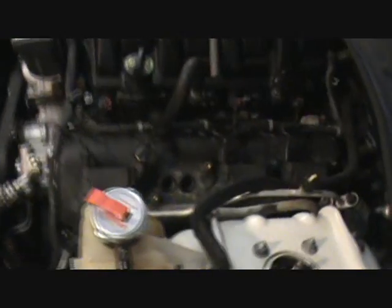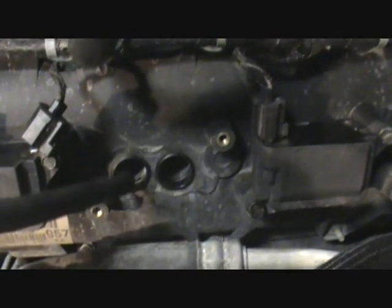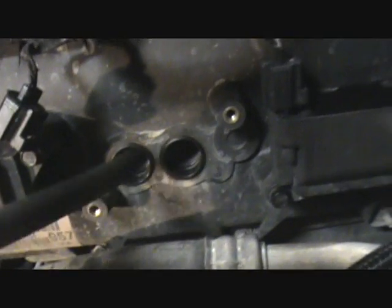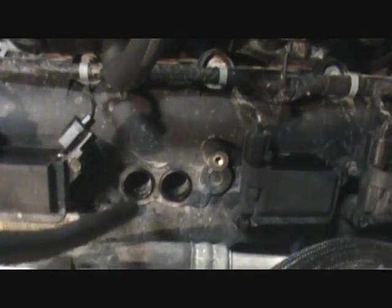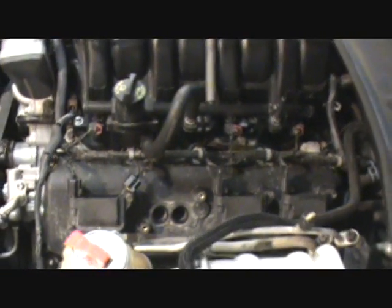Alright. Thought of another tip. I take this tube that we use for the spark plug installation and removal and put it in here before taking out the old spark plug and blow into it and make sure there's no foreign material inside the spark plug hole that would fall into the engine, which would be super duper bad. Okay, that's just a little tip.